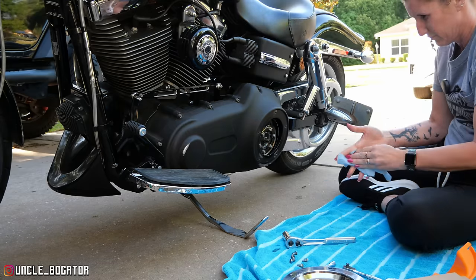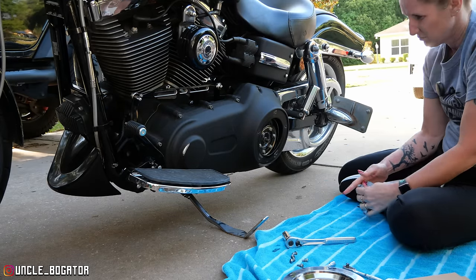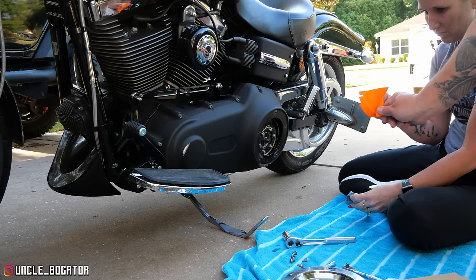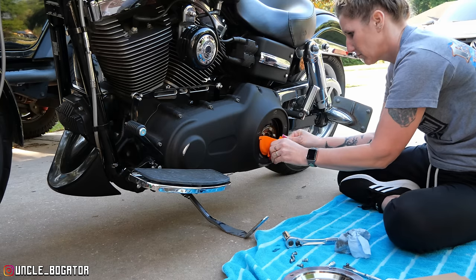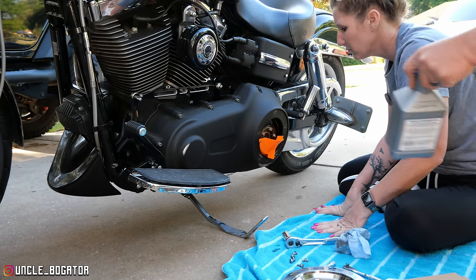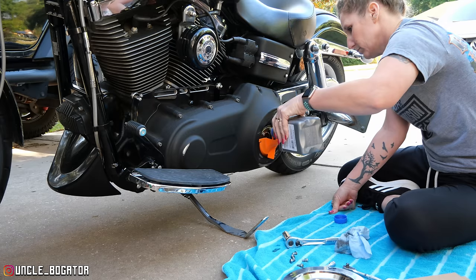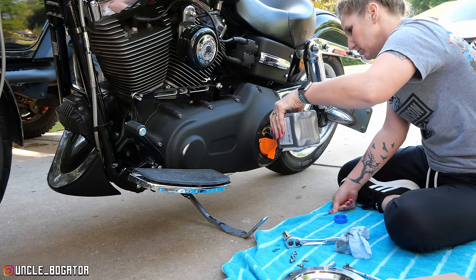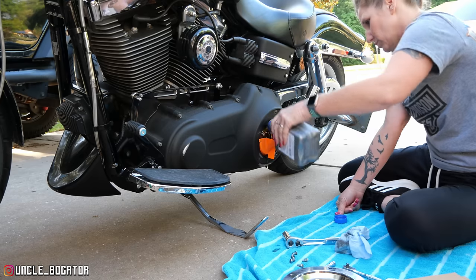All right, now Harley Davidson, being the masters of selling you a solution to the problem they create, hard to get oil in there. So they made a special little funnel. It slips right down on the inside of that lip. Yep. And then we're gonna put this entire quart of AMSOIL in there. Pours right in there? Yep. Pour the whole thing? Yep. For your bike, it's a quart. For my bike, it's 38 ounces, so I have to use a quart and 6 ounces.